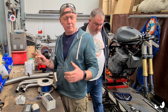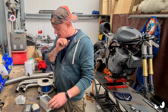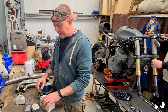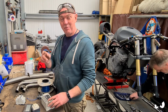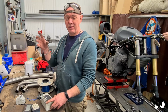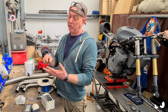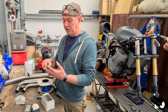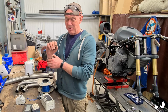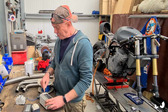The Boxford lathe and the milling machine were all originally 3-phase. But the mill was converted to run on single phase on 240 volt, and we were chatting the other day, and he's bought loads of goodies with him, and we might be making it 3-phase again. The idea is stick a 3-phase motor in, and some of these other doohickeys, run an inverter, so I can get it back to 3-phase. Because the trouble I've got at the minute is if I try and run it on the highest gearing, the highest speeds or the lowest speeds, the 240 volt motor just doesn't have the torque. It really does struggle. Whereas a 3-phase setup is the way it's designed, it's meant to do it, and it does it very well.